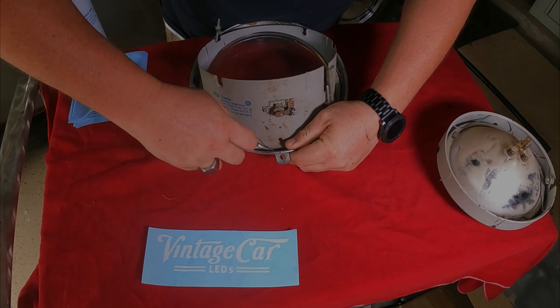This is your parking light and this is the parking light plug. This is an earlier car so it's the screw-down terminal — some have a spade terminal — but it's held in with one screw and the whole thing should just pop out. We'll have to replace this bulb anyway because it's a six volt and we're doing a 12 volt conversion. I'm not going to take this off because it looks like it's on there pretty good. Let's get these all wiped down, get that new lens on, get the chrome clean, and then we'll move on to the actual headlight itself.